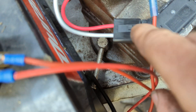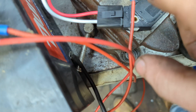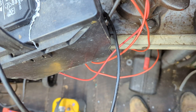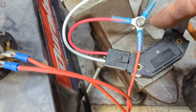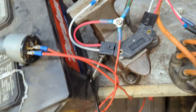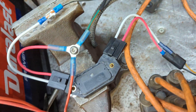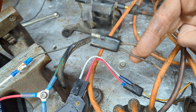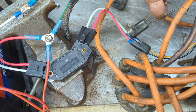The blade that is lettered B gets the red wire — the red wire comes out, goes to the ignition switch, which goes to the positive side. It also goes to the positive side of the coil, that's why there's three wires right here — so that goes to the positive side of the coil and makes the whole thing work. Now before you say anything about this jerry-rigged bit here — this is what I'm going to eventually be using, but I didn't want to ruin it to temporarily hook this up.